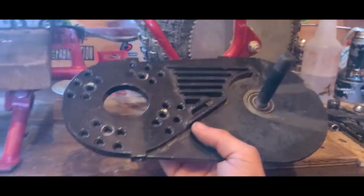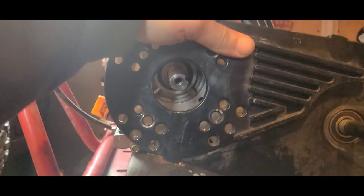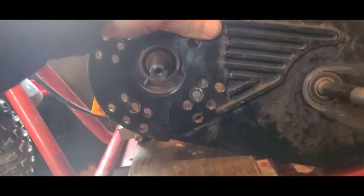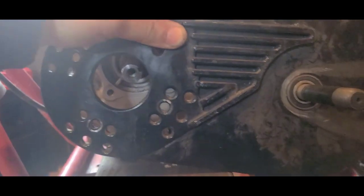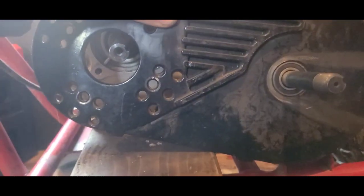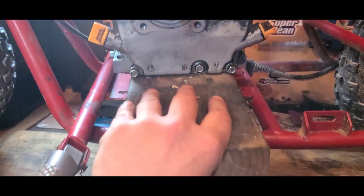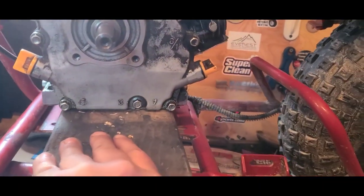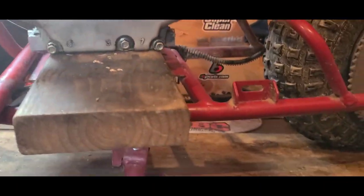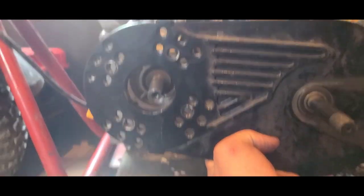I'm not going to wait for paint to dry to figure out this next step. I'll just prop a chunk of wood up underneath my engine and I'm lining up the holes on the block with the factory slots on the factory engine plate. I'll take a torque converter mount and hold it in place — we're going to want to be centered on our output shaft. If I'm centered right about there and come back, we're definitely touching.